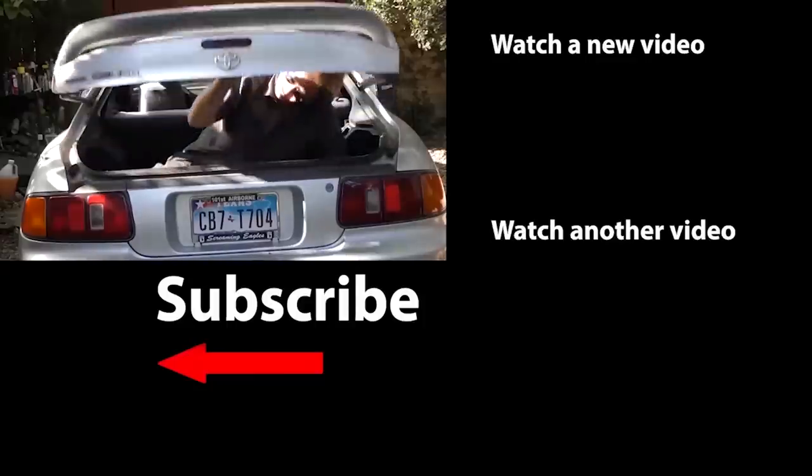It should relearn itself. Now, if it doesn't, you're going to have to go to a mechanic, and we have the fancy computers that can reset all the idle learn. There's a little button that says reset idle learn, yes, are you sure, yes, and then it resets it and works perfectly fine. But that's set up for 2.5 to 3 minutes of idling with the AC off, then drive it around, especially on a highway, for 15, 20 minutes, and it should reset itself.